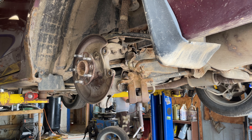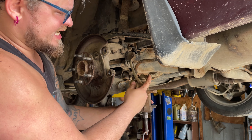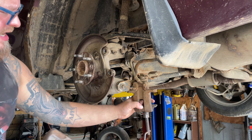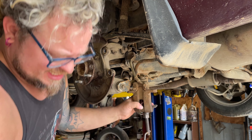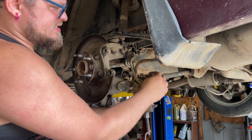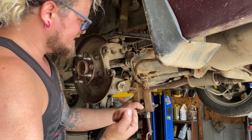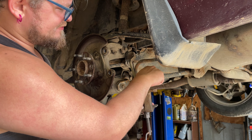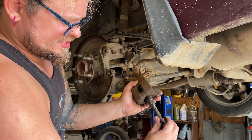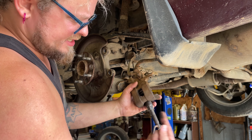I'm back at it guys — it was not a bad caliper. The caliper turned back fine. The e-brake cable was partially engaged — like halfway engaged — and I just took my hammer and hammered it back. What we have going on is a stiff e-brake cable: once you engage your e-brake, it pulls but doesn't return. That was the problem. After I freed the cable, this turned back in real easily — I just spun it right in.